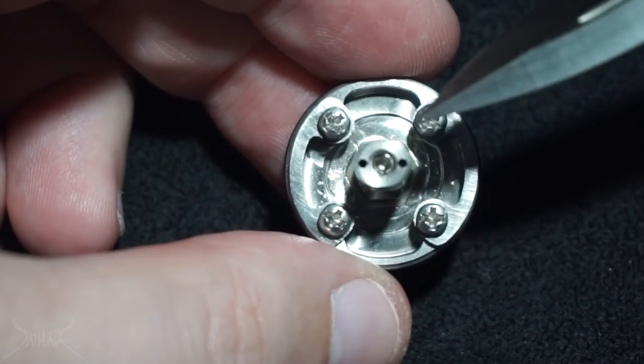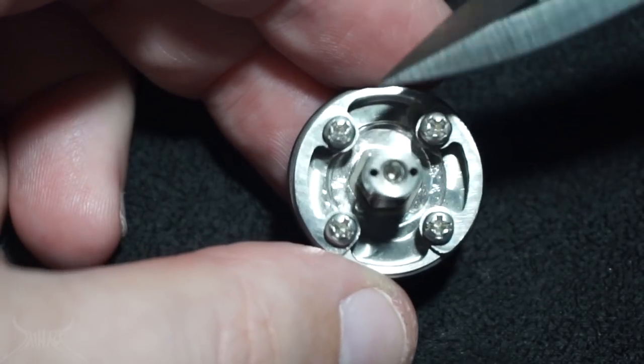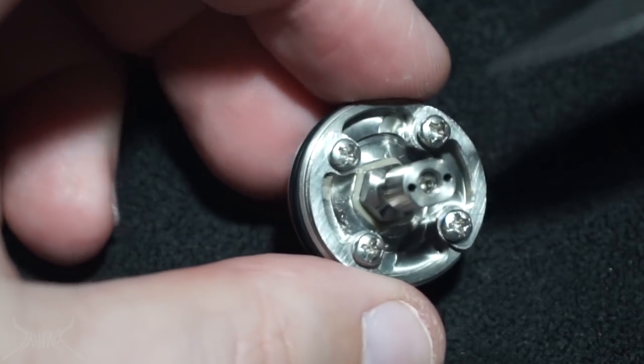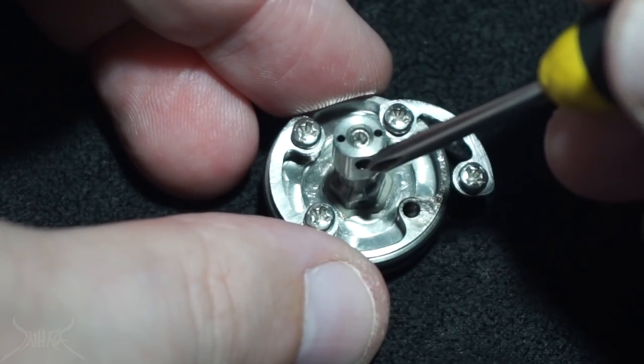Does resemble the 454 big block, but there is quite a good amount of differences, which we'll go over. Instead of your original clamp that was kind of a ring around, it's two additional C-clamps versus one as a whole. And the reason why that is, when you unscrew one, clamps may be in the other direction where they're directly in front of the port.